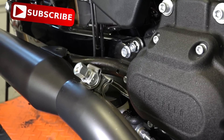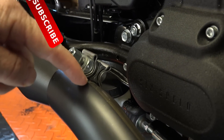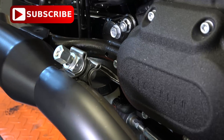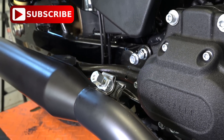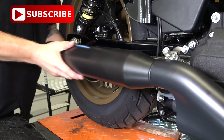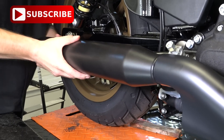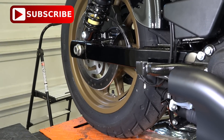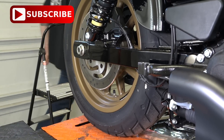So if you do need to lug them, this right here is where you'd want to spray WD-40 or something, right up here where the mufflers go over the headers. That can help especially if the bike's a little older and they're really welded on there. He's going to start working on this rear — or top one, I should say. Top and bottom exhaust mufflers off.